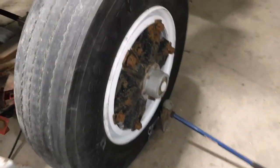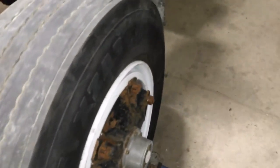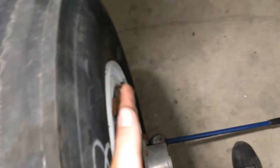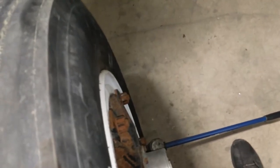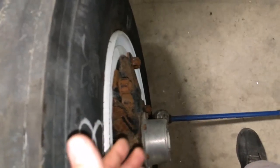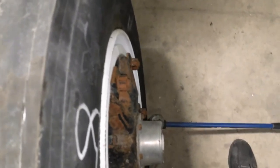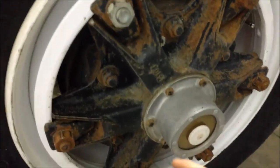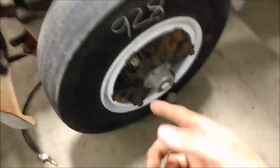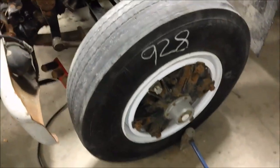And it's the same with the reversal. The only difference is you have to true the rim, which is why I left my hammer here. Basically you put it up against it and you spin the tire. It's a little dark in here so I can't show you, but it's about an eighth of an inch true. Since the tire is up on a ramp, you have to decide how much it's wobbling on the rim or the rim sitting on the hub. It just runs up a ramp — there are no predefined slots for it to go in. So you have to torque down the wheels accordingly, in a star pattern, using the same amount of force and turns on each one. If you're using your impact, just go the same amount on each one so it goes on as straight as you can.